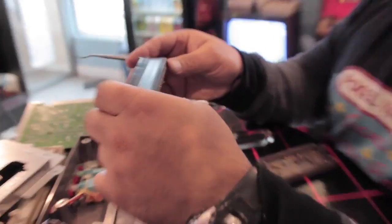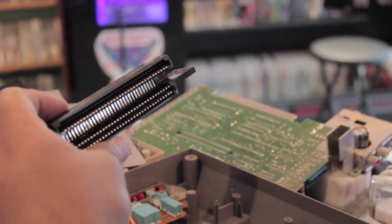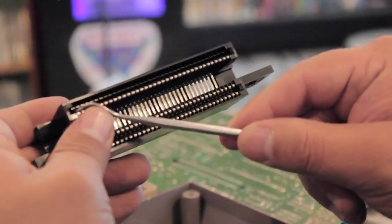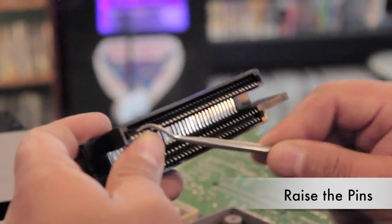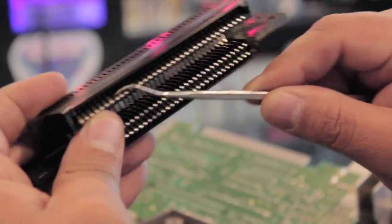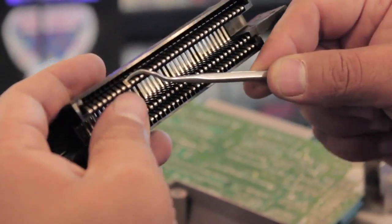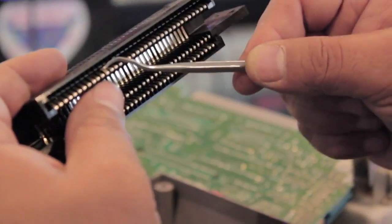Here's where things get crazy. Sometimes Nintendo games don't work and people have to put them in, push them down, clean them — all kinds of stuff. All I do with this hook is get in there and just pull it up. Do not lift it all the way up to where it hits the top — just enough so it's raised up. I raised all these pins one by one, just take your time. It's better using the original Nintendo NES pins — they're gold-plated, a bronze color, and make better conduction than those new 72-pin connectors sold online, which are just galvanized and you'll struggle with them every time.